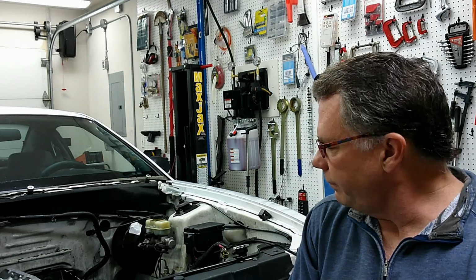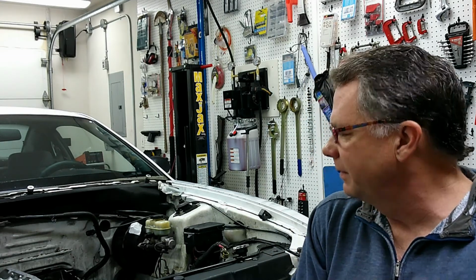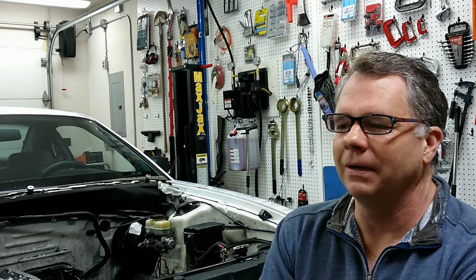And I guess the thing that I've learned with this project so far is that the valve lapping is pretty darn important. This is my 4th or 5th engine rebuild. The very first one I did do the valve lapping. However, I did not test the integrity of the valves before putting it back in. So for all I know, it was leaking a bit. And for the other motors up until this point, I didn't even bother doing that. I just looked at the valves. Yeah, they look good. Threw it back in the car, and I lucked out.